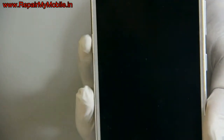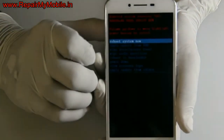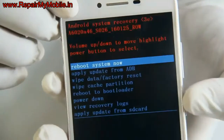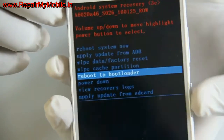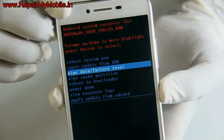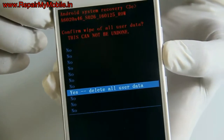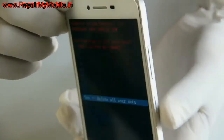As you can see on the screen, it will come to another menu. In that you have to select the option 'Wipe Data / Factory Reset' using the volume keys — that option starts from the top. Use the power button to enter into the sub-menu. The same key combination — power and volume up — is used on other Lenovo mobiles also. Here press the power button to enter the sub-menu, then select 'Delete All User Data' and press power. This will delete all the data from the mobile. You can use this process if the mobile is running slow or hanging frequently.